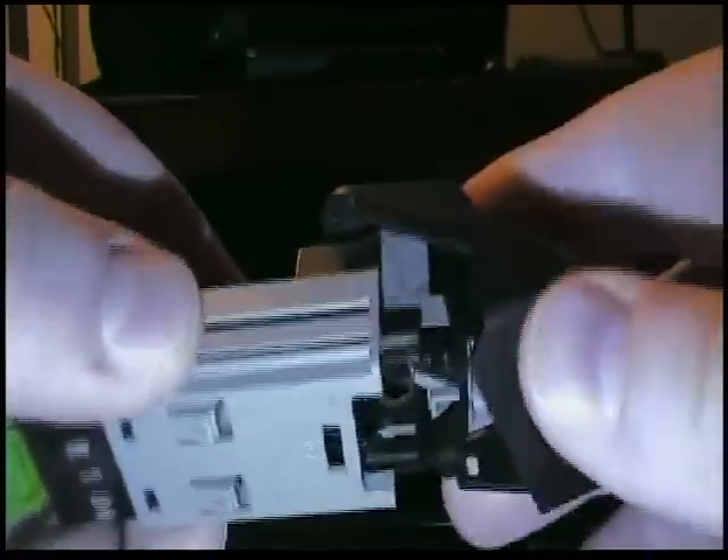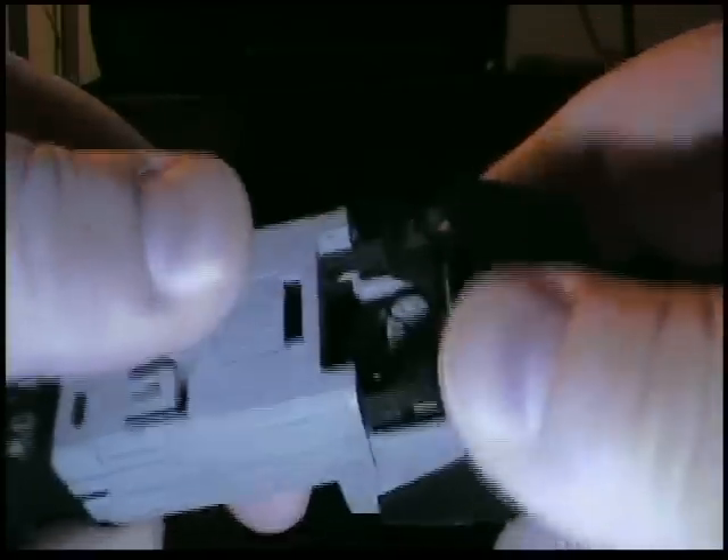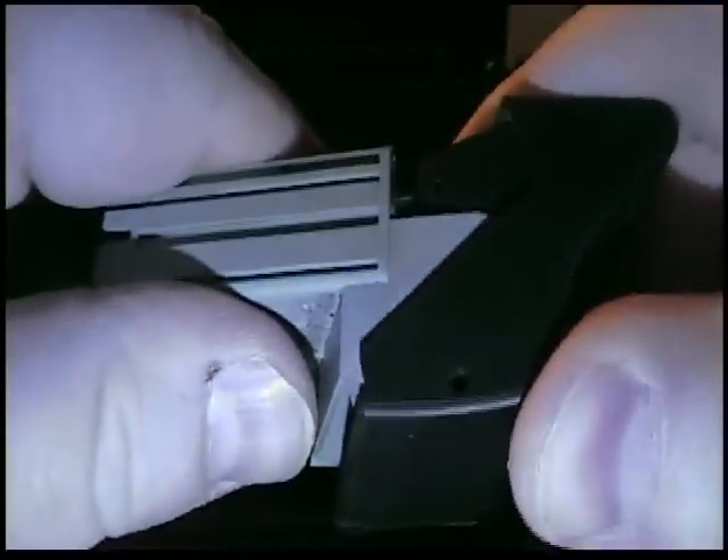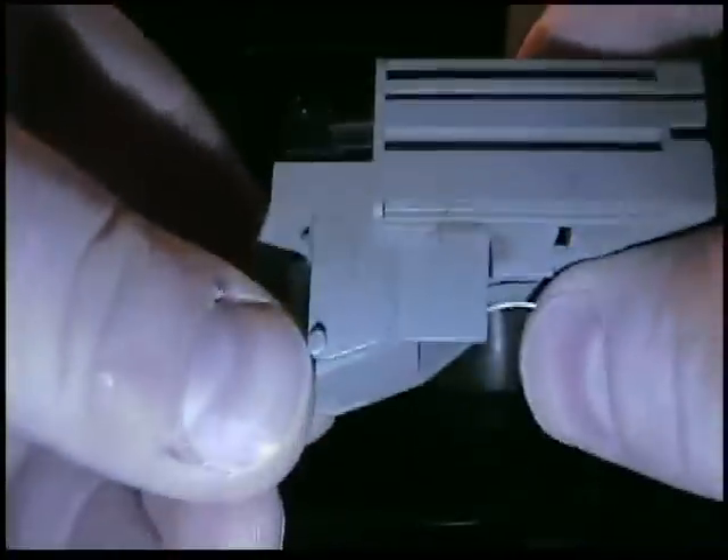There's a certain way you want to get these back on. Since we got the two tabs out here, I pin them in there like that and come around to the top and kind of snap it all together — you can hear the popping from the switches. This one had a broken tab on the corner before I even got it. The tabs usually have a little hole that pokes through, and you've got the hidden tab and the two on the bottom that I showed you. That's the actual switch — this is just the rotating arm with the light bulbs in it.